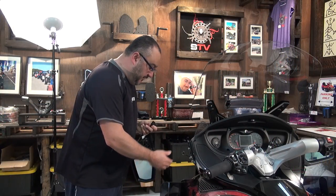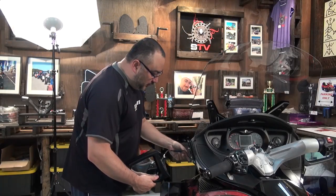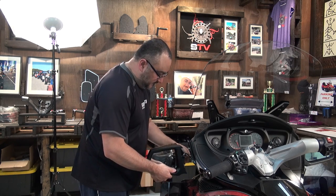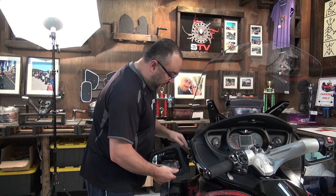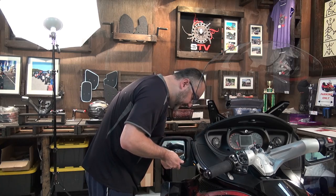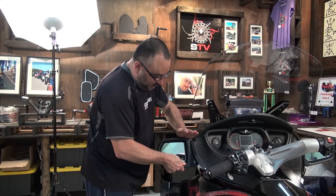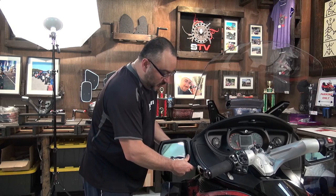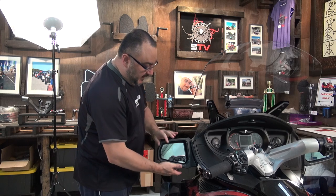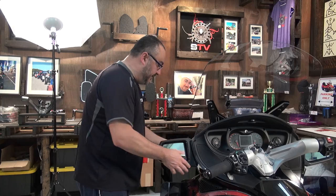First, make sure you put back the plug. Once that's done, push in the wire, then line up the top part right into the pin that's there. Once you feel it's hooked at the top, go ahead and push the bottom one — I felt it click — then the front one. When you push the mirror, you can feel that it's hooked on top, at the bottom, and at the front.